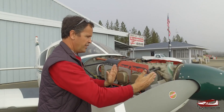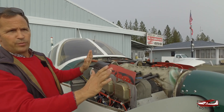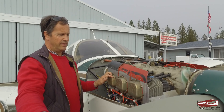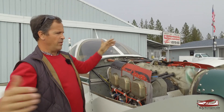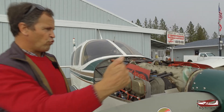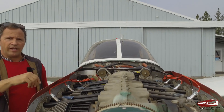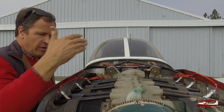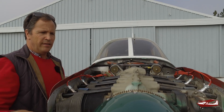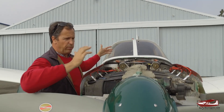With the cowling off — if it was just four cylinders, it would be an O-360. Two more cylinders: 540. And weirdly, but not in these planes, two more cylinders for a flat eight would be a 720 — that's what's in the Comanche 400 and the Queen Air; that's an enormous engine, the crankshaft is like 22 grand. So this is a carbureted 540 Lycoming with a 2000-hour TBO. Interestingly, if you look straight down the spine of the engine, the windshield center and the rudder are in a dead straight line, but the engine is fairly significantly offset to one side. That offset counteracts P-factor and torque — the twist in cruise would make it yaw — because it's such a short-coupled plane with such a big engine.